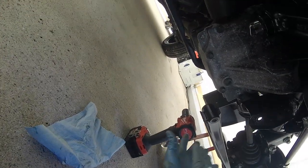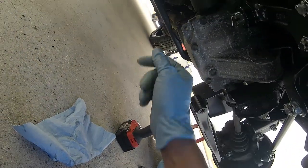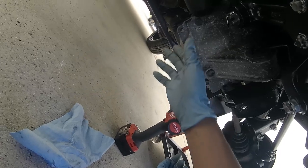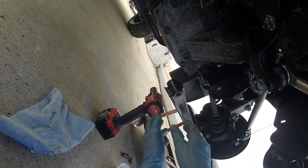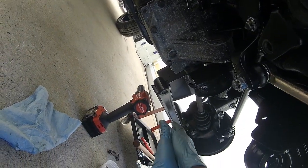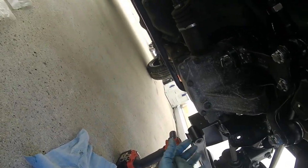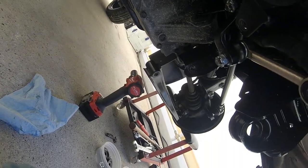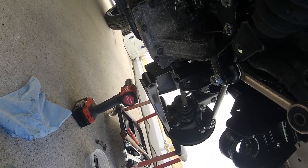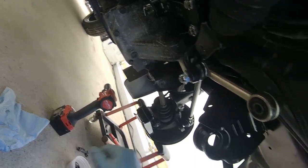Next is the control rod, and this is where I'm hoping that I fix my center to center from front tires to rear tires. I did do some math on that. It's almost a 5/8 plus difference between passenger side and driver's side here. I think it was like 17 millimeter difference,